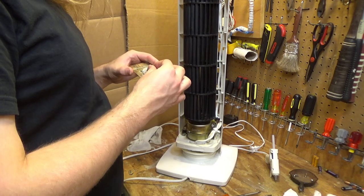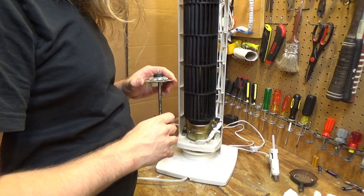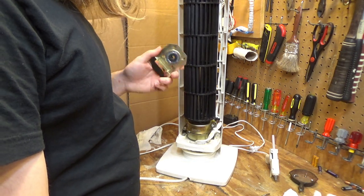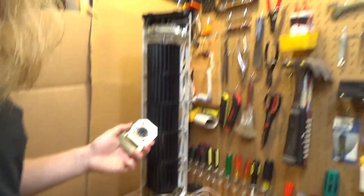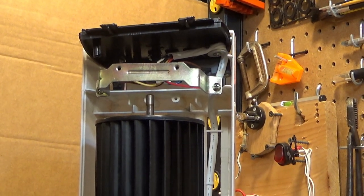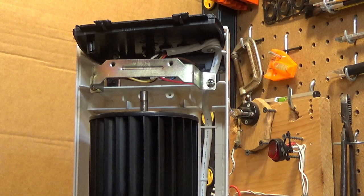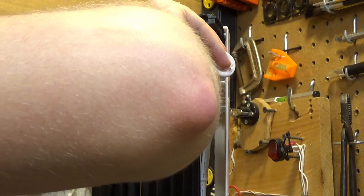This crazy top bearing. I think it's reached the point where this bearing has enough play inside of there to actually spin within the rubber. So that's no good. But I don't want to put any glue in there because that may cause it to not be able to move enough to align. I believe this can be oiled once it's in place, so I'll just put a little bit of oil in there for now. Well, that was actually more than I wanted, but whatever.